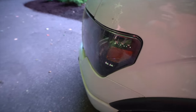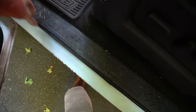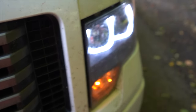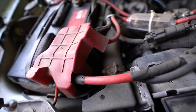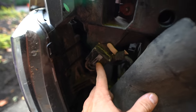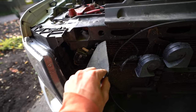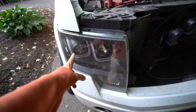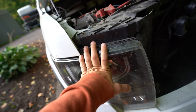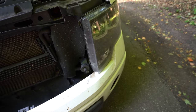As far as the exterior of the truck goes, there's really not too much that's not stock. The first thing I did was redo the headlights — these are HID lights, actually the ones that the Raptor runs. In order to do that I had to run a converter to HIDs because my truck stock couldn't run them. There's a module tucked behind the wiring. I'll include links in the description, but this mod was probably around $500 all said and done — HID lights are expensive, and the housings were about another $250. They give a really good angle when I'm driving on back roads.